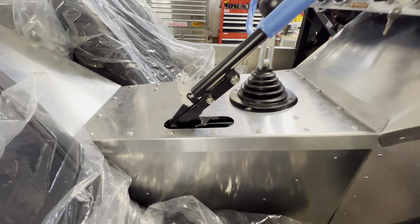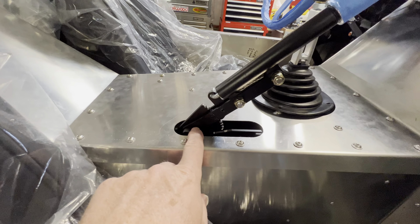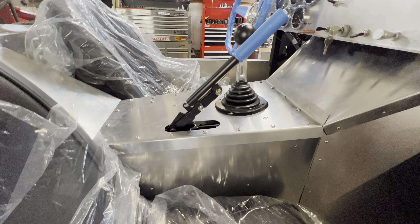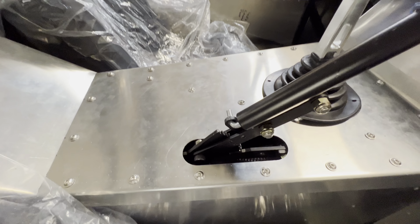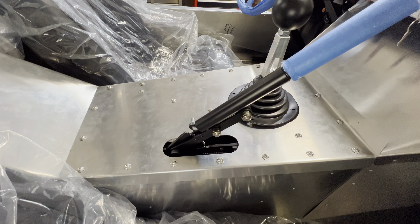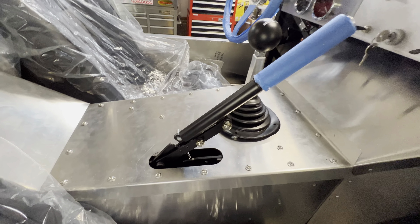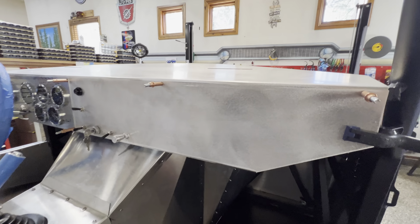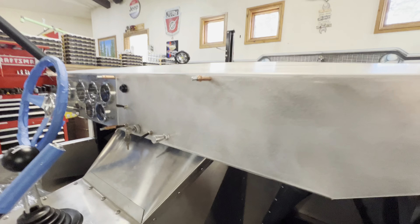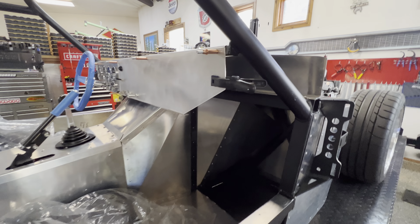The center tunnel — I decided to put rivnuts on that so I could remove it. It seems to me that if you ever needed to adjust the park brake, it would be very difficult to do from underneath and can't do it at all from the top. Plus, I like the look of the rivnuts, so I put in standard spacing, which is three inches when going into the tube that Factory Five recommends. I put in certainly more rivnuts than it needs, but I like the look of those. I'll probably do a lot of rivnuts on the dash as well.